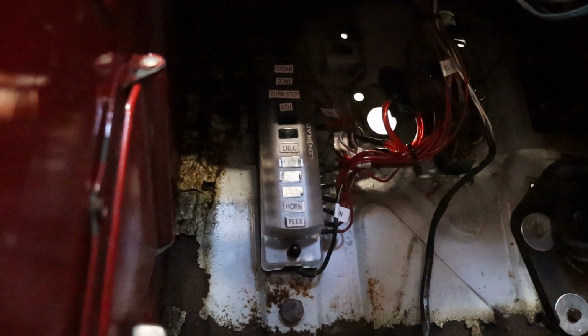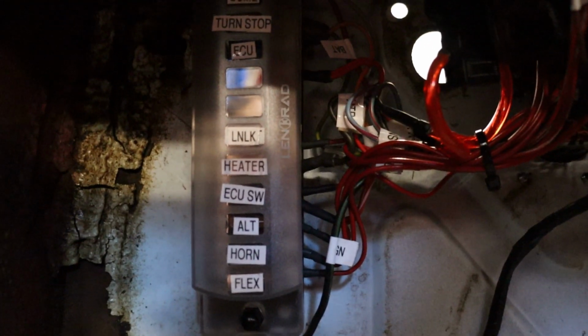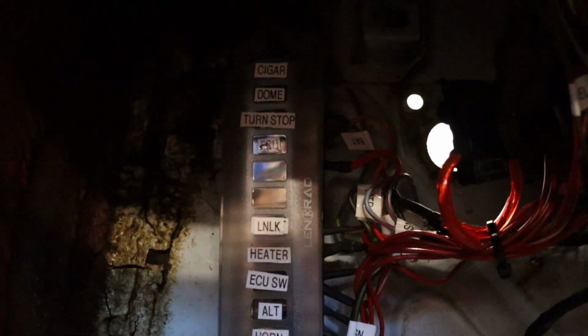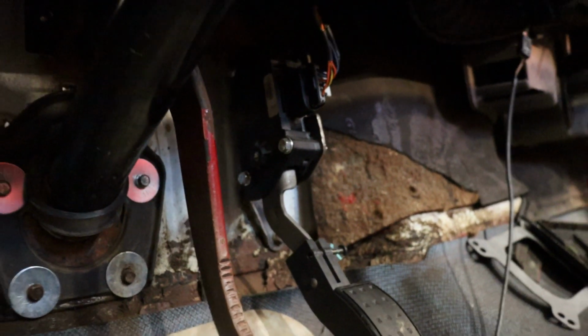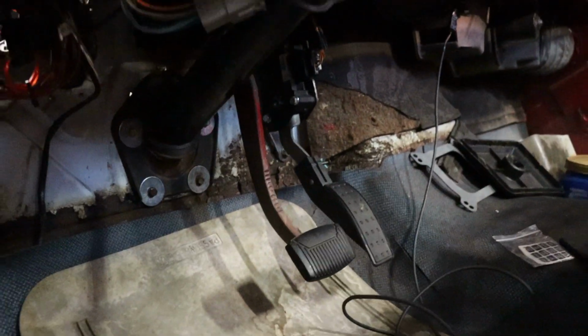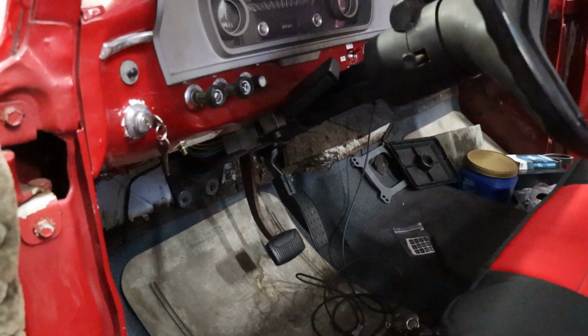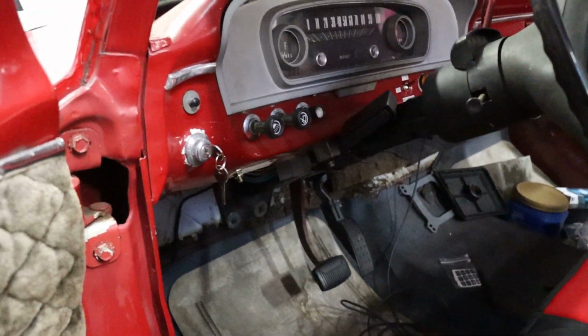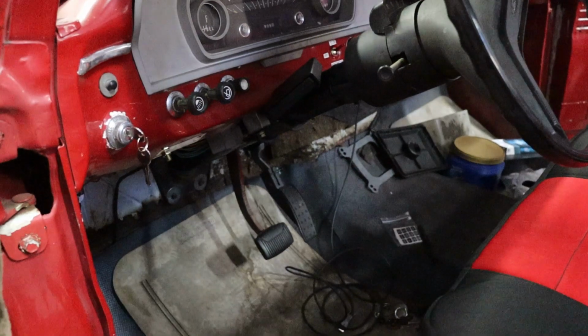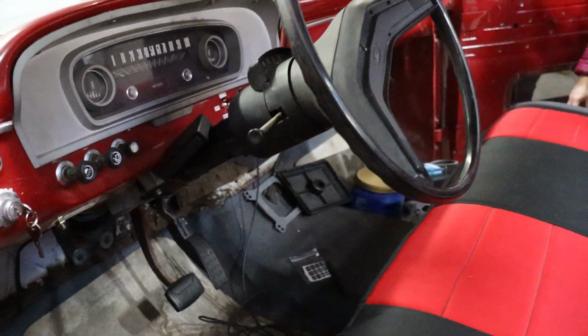Also, we had to add a bunch of extra stuff into the wiring system. So in order to do that, I wanted to get a fuse box that had a lot of extra fuses in it so that it would be easy to add additional components. You'll notice that we're also running drive-by-wire. This plays into the traction control. We have found that doing ignition-based traction control and drive-by-wire-based traction control has been very effective. We're actually modulating the throttle in response to tire slip. It's worked pretty well in the past, and I'm gonna try that out again on this truck as well.